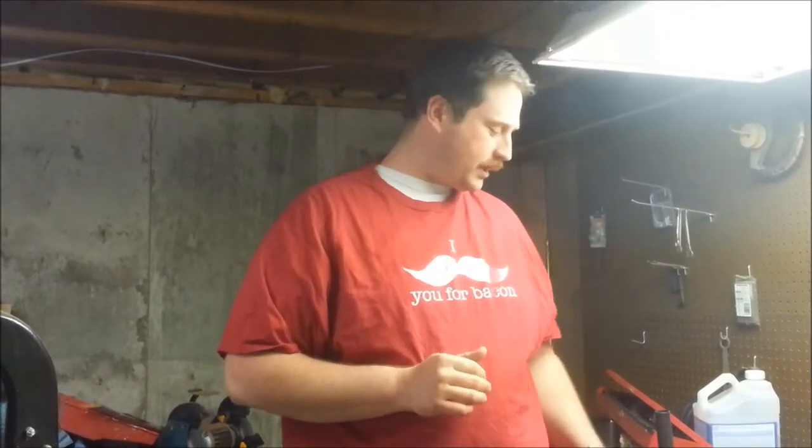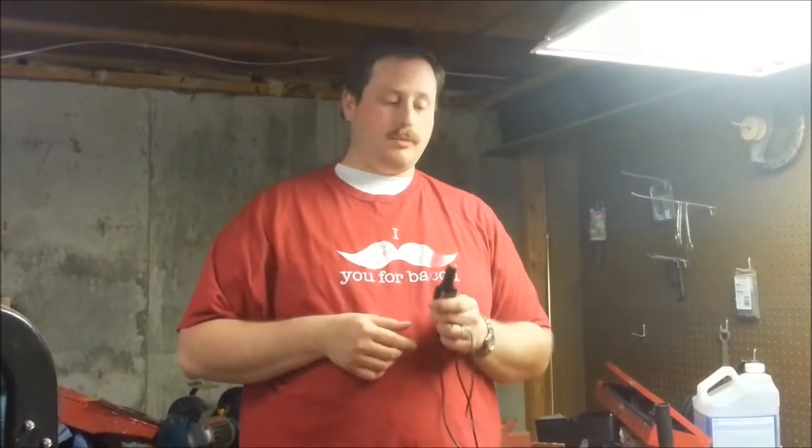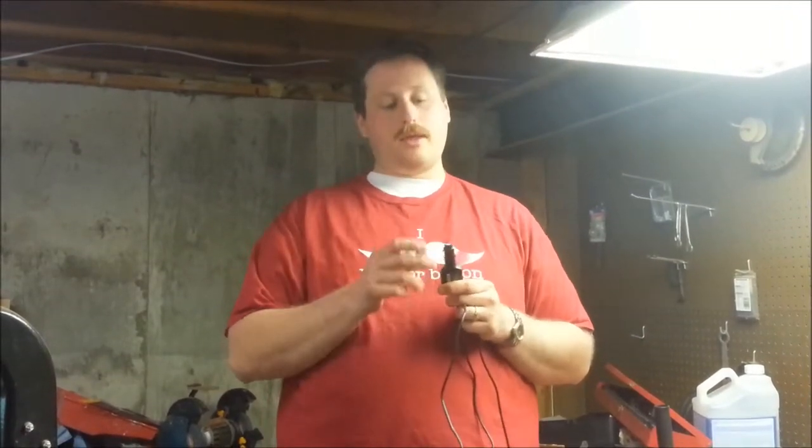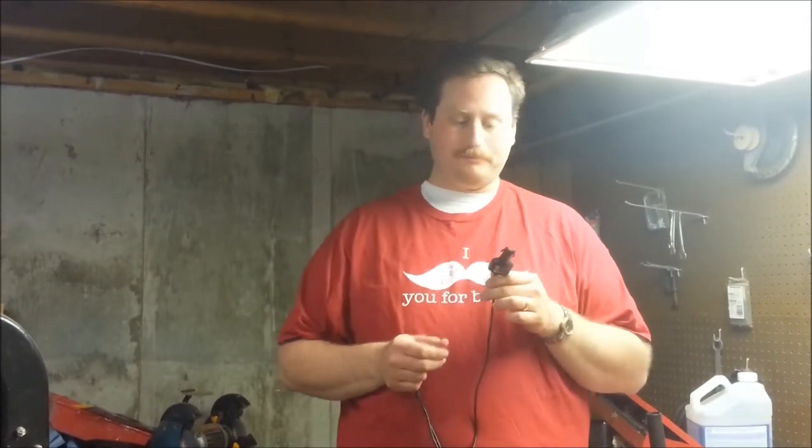I've had to rethink a little bit how I'm going to do this. The first time I did this project I was actually able to use the original charging cord without having to really damage it, so you could completely go back and undo what you did. It was completely doable just by putting a wire here — this is your ground — and then the live up here, wrapping a nail around that and soldering a wire onto it. I accidentally broke my adapter trying to do that, so I'd say don't try to hammer the nail on — use pliers to pinch it on there.